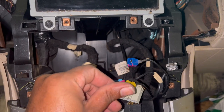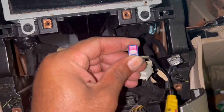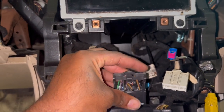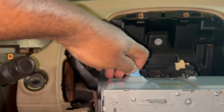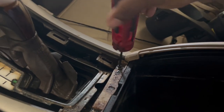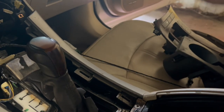Push it in and it will lift this thing up so you can just push it like that. This one's fairly easy. All you want to do is push the little back end right here and it will literally snap — that's how it should go. This is pretty simple; most cars have it like that. I'm gonna go ahead and take the screen out. The top piece is fairly easy — you've got two bolts right there. You'll need one of those little star key sockets, and you'll need a few of those. That was pretty easy.